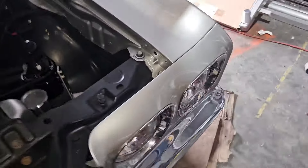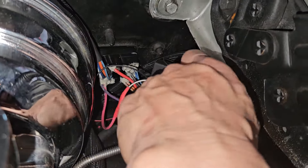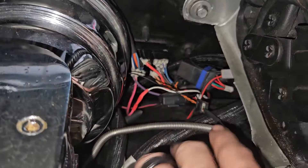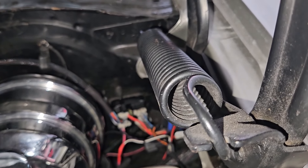I called Jim and said hey, found what the issue is — something inside that box is acting weird, but if I disconnect the wire everything's perfect. We need to order the BIM module. I'm going away so the box won't get here in time, but I want Jim to have his car back. It's a very easy box to install — it plugs right into the Holley CAN port, that four-wire port, technically two signal wires plus ignition and ground.